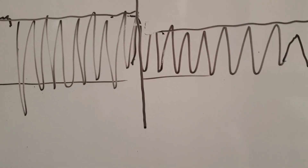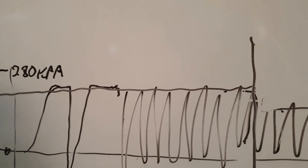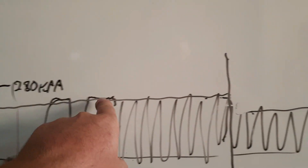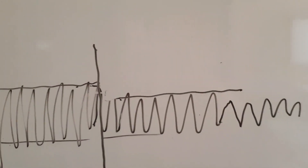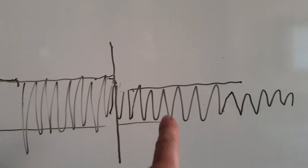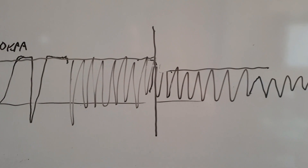So I never looked at the actual number at the end of the chart — which is what I did wrong. My bad. I should know what this number needs to be, the peak number, and I should look for that and identify whether we're actually reaching our target or not. And I didn't. So we spent the weekend driving around on 11 psi rather than 19 psi. My bad. Small power reduction there.